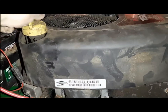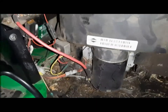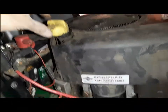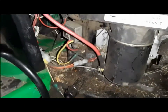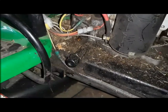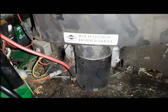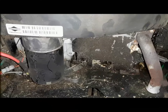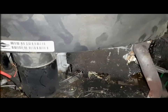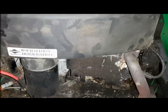This is the oil dipstick. So to change the oil, you just have to take it out and open this one. So this is to make sure air can flow. And as soon as you open this, hold the bowl, oil will come out. And you can put the new oil. Put a synthetic oil actually, that's a lot better. And run on premium gas. Synthetic oil and premium gasoline. That's the trick of lawnmowers, riding lawnmowers, small engines.